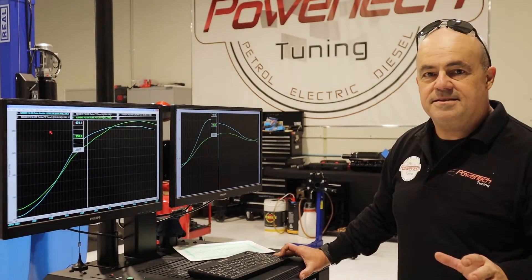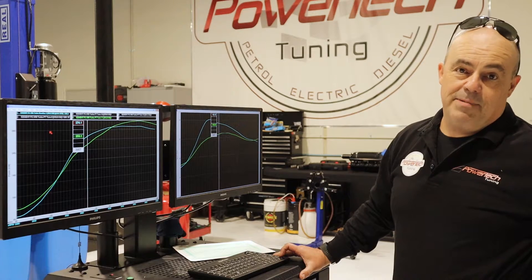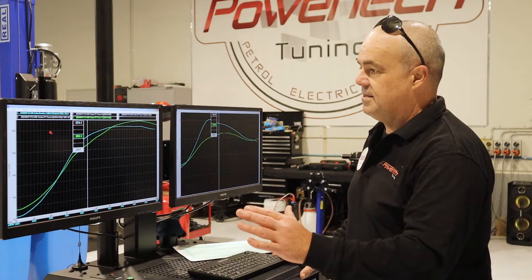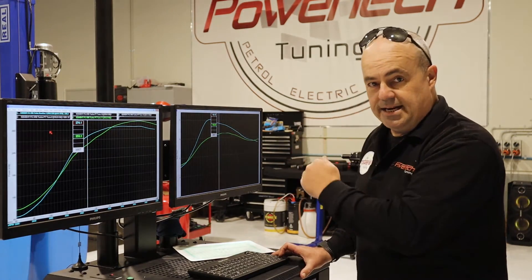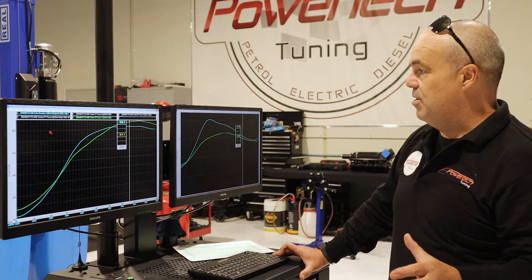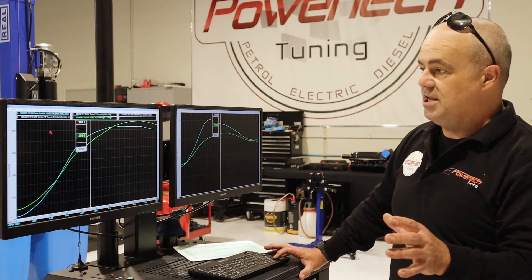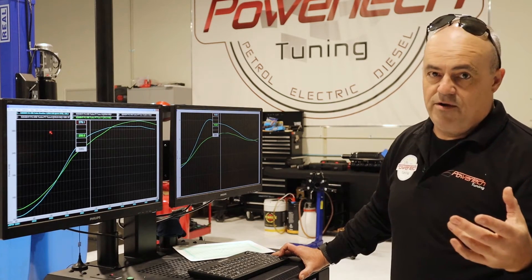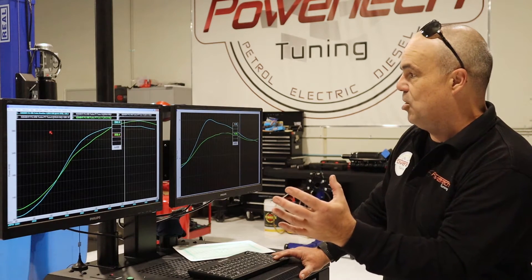This is one instance where we're quite happy to give away some power and torque in the middling rpm of this engine. What happened standard is the car came up to 21-22 psi, boost curve dropped off, heat loaded the engine, made the engine detonate, and we ended up with a maximum of 298 kilowatts at the rear wheels. Now we've retuned the engine with a proper flat boost curve, not getting it over a bar of boost, and tuned some top end into the motor.